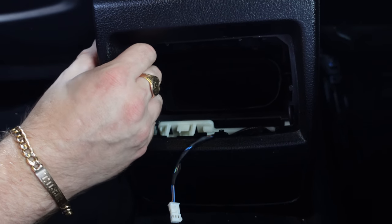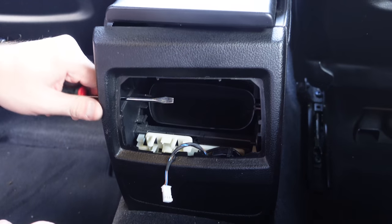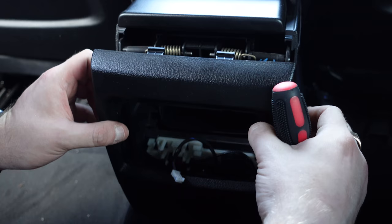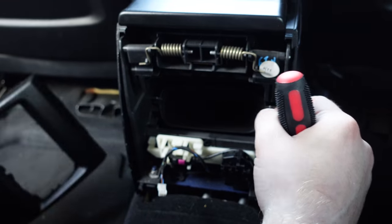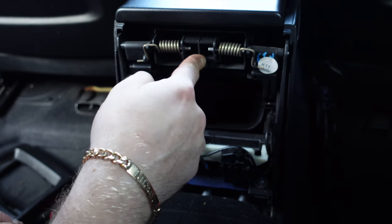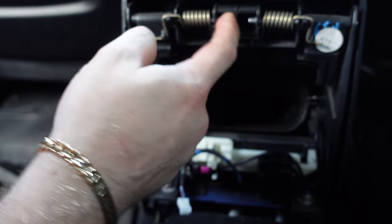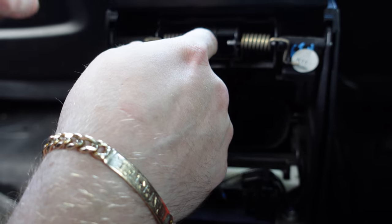Now you're going to take off this trim right here, which is going to come off as well. And there's the other trim off as well. Now to remove the armrest, you are going to have these locking tabs right here — these are the springs. You're going to have to remove that. Just down here there is a bar that you need to pull up and then slide these sliding pins out of each side to be able to release the armrest.